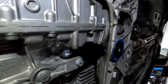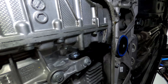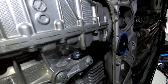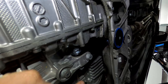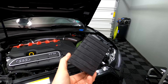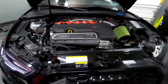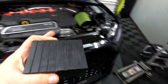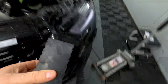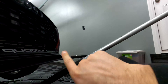While I'm under here, I'll mention I already have the East Coast Euro or ECE dog bone mount in. The BFI mount should complement it pretty well. I do feel a little bit of NVH in the steering wheel and pedals at idle — nothing too serious — but the dog bone mount is absolutely awesome. It cleaned up a lot of the slop out of the drivetrain and helped immensely with shifting and putting power to the ground, and the BFI mounts are going to help even more. I'll be using this hard rubber block that came with my quick jacks between the jack and the bottom of the engine. You can use a small piece of wood too — you're just using the jack to support the weight of the engine and move it around a little to line the holes up.